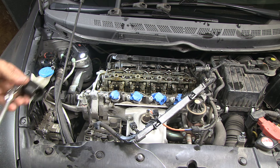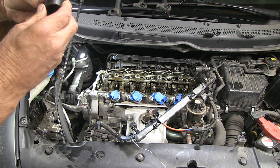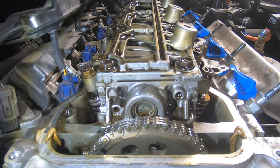If this doesn't make sense, it will once you watch the video. If you don't know how to remove a valve cover, watch my video linked in the description. I'll be using my ratchet with a 24 millimeter socket to rotate my engine using the alternator. I already removed the spark plugs, which is why I'm able to spin the motor over using the alternator nut.